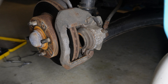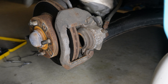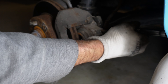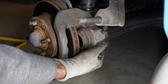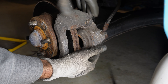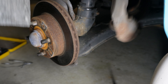They're out. What I need to do is get this whole caliper off. To do that, you undo these two bolts at the back — they're 19 millimeter. This piece is what the bolts screw into, and it slopes away towards the back of the car but inwards. The caliper will come off now. I'll need to compress that piston back in but just for now I just need to support it — we'll hang it and hook it up so it's out of the way.